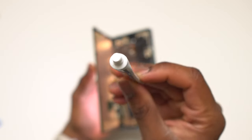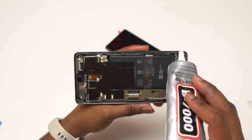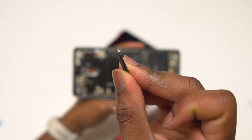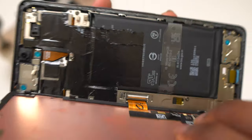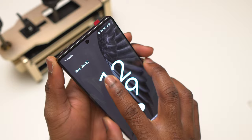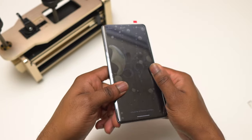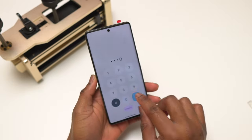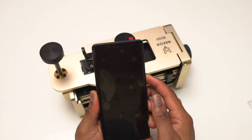The Pixel 7 Pro screen didn't come with double-sided tape — instead they provided a small B7000 adhesive, but I'll be using my own larger B7000 which is already open. Make sure you don't forget to add the retaining plate after adding the B7000. I added a small layer of B7000 on all four corners — right, left, top, and bottom. After that I installed the screen flex cable, added the retaining plate, and closed the device. After closing, apply force on all four corners — you'll hear clicks when the screen is sealed.